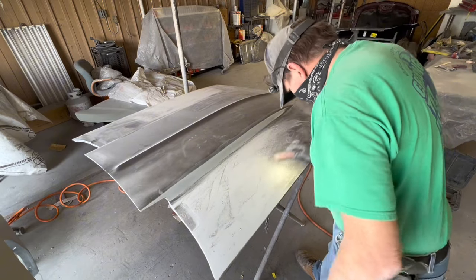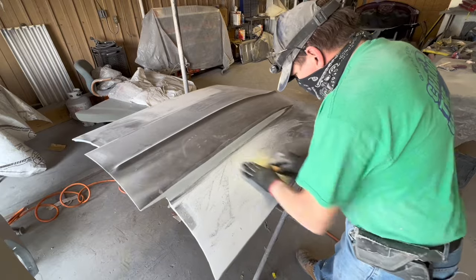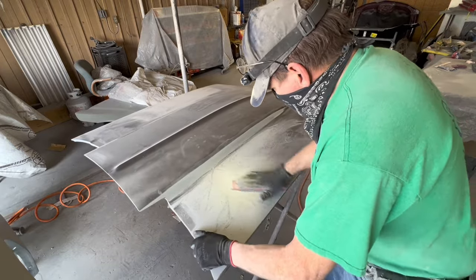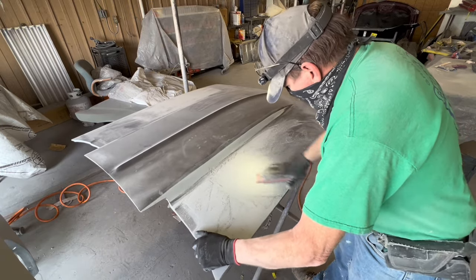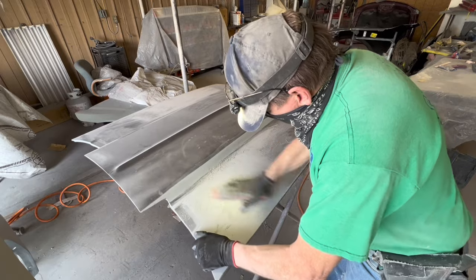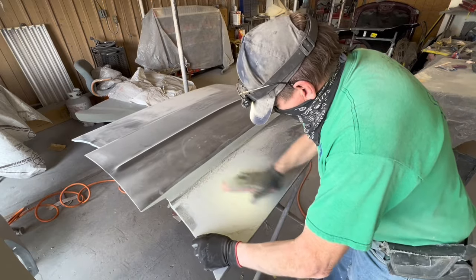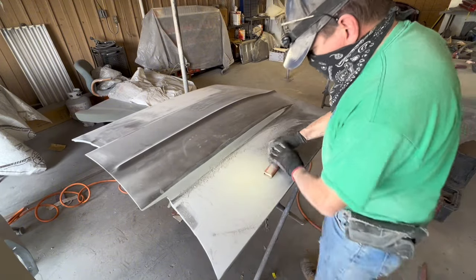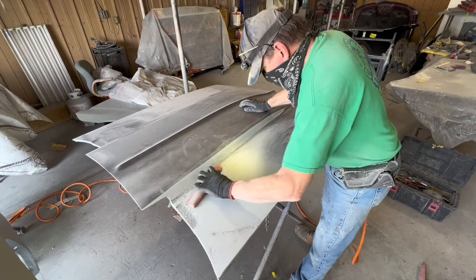And I'll say it again, my fellow YouTubers, my YouTube buddies out there that enjoy my videos, I'm not trying to hurt your feelings. I'm just telling you straight up, if you've got a 16-inch block, you're wasting time. You should put that thing in the bottom drawer of your toolbox, and I don't know what you could use it for, but you shouldn't be using it for doing straight bodywork and primer blocking because it's the wrong tool.